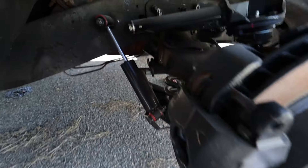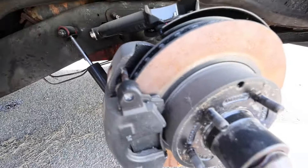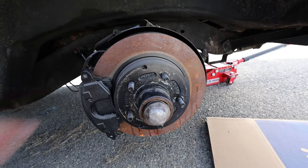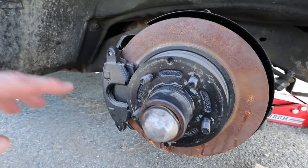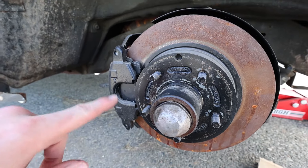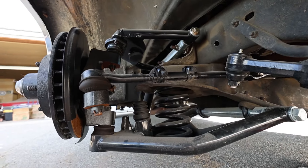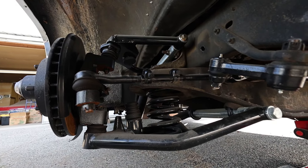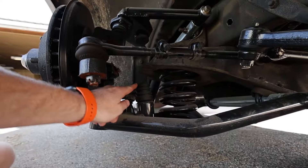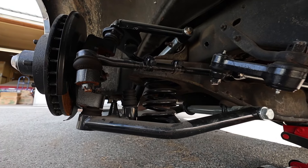It is a little dirty and dusty under here but look at that sweet pro-touring suspension. We've got a little bit of surface rust on the front rotor but not too bad. I do want to upgrade later on once we throw some more horsepower at it - maybe even get a four-piston setup up front. I haven't seen any branding on it yet, but I know it's high quality stuff because my uncle was no slouch on anything. I also noticed it has been sitting on the bump stop, so we'll have to raise it up anyway.